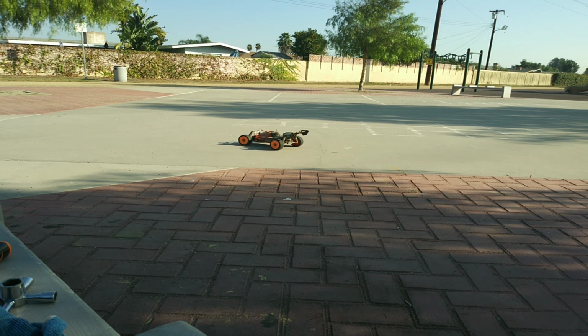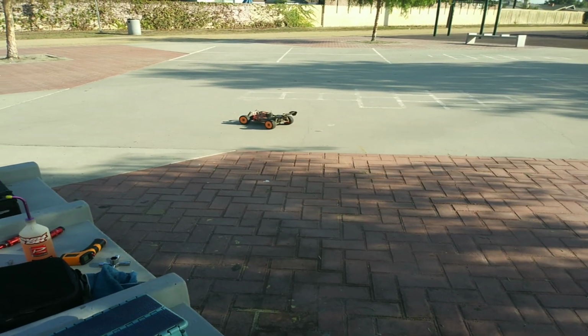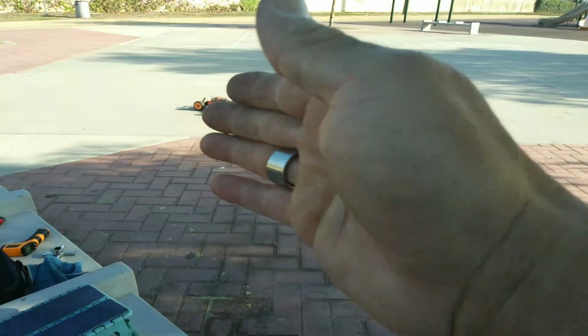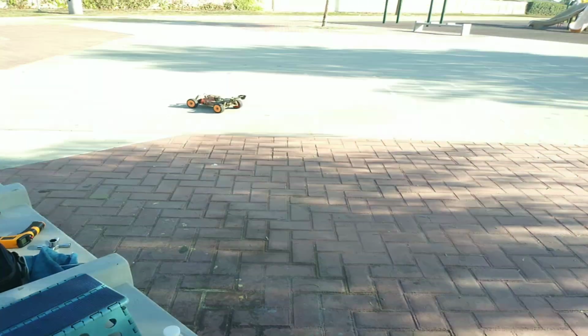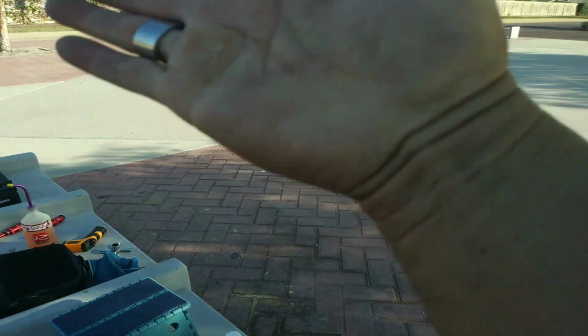All right, you guys have seen about as much as you're going to see out of me, people. There's a good 40 minutes of brap session. NB48.4. First time modded, RB modded, Reds, R5 Team Edition, 9886 Novorossi pipe, 41032 header. She's brapping. Did I say I had a 14 on here? There's a 13 on here, man. I need to put a 14. I can run a 14 on mods, because 13's more if you're just running bone stock 21s. I need another gear top end. It seems like it wants to pull more, maybe even throw a 15 in it. All right, people, catch you guys back at the cave for the wrap-up edition, overview, thoughts, concerns.